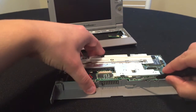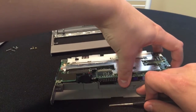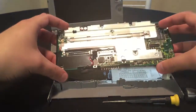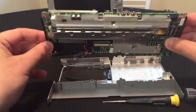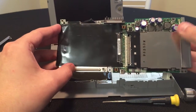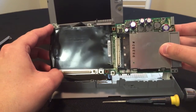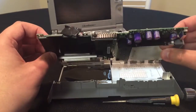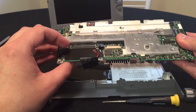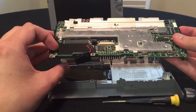Let's go ahead and remove the main board now. Again, be very careful. I do have a wristband around my ankle just to keep the static at bay. My table where I live doesn't have a lot of static, but I am placing the main board on the table. So your hard drive goes right here, here's your PCMCIA, there's your dock on the back end, you've got your capacitors. I've actually had to replace a capacitor on here as well, but actually the original capacitors were in really good shape — I hadn't had any issues with them. Here's the CMOS battery that I actually had to rewire and get a new one — the old CMOS battery went bad. I believe it's rechargeable where you plug it in and it actually charges the CMOS battery, though don't quote me on that.